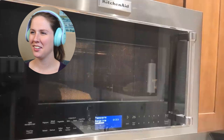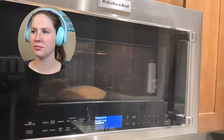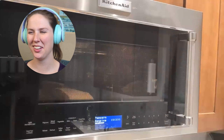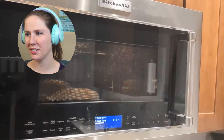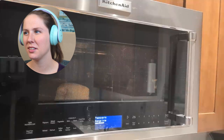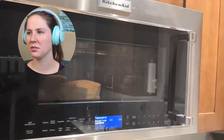The other twist with this microwave is that it doesn't appear to cook popcorn at full power — it takes noticeably longer than the Samsung machine does, and indeed most microwaves I've ever used. But it doesn't have an inverter magnetron, and I don't hear it cycling. So unless it's got some sort of half-wave rectified 50% power mode, I don't know what it's doing. This microwave is also weirdly slow at melting butter, but not at heating things in general. I'm honestly not sure if the slow popcorn popping is intentional, but by golly it nails it every time, so it's definitely worth the small added wait.